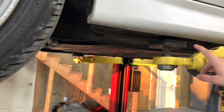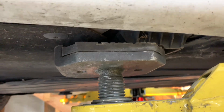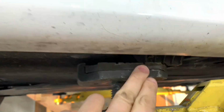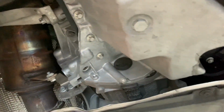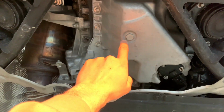So practically what it means is it's good for low cars, it's perfect, and it's very light, so you can easily carry it around. If you are going to lift these Beamers, look underneath right here, they have these little spots where you put the jack. I'd suggest you put it here. Don't put it anywhere else, because usually this is the strongest spot and it's made for lifting. Then you're going to want to go underneath here, and this is the hole where you take out the oil. So it's going to come out right over here.